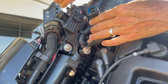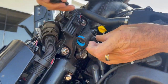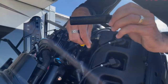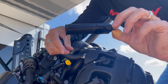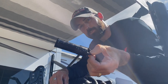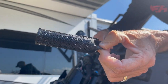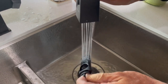And there it is. So before, there used to be a cigarette-type filter that went through here and out here, and you didn't have to take this off. Now they've gone with a much bigger filter — before it was a cigarette, now it's like a cigar, so it's a lot bigger. And this is not that dirty to the eye, but if I hold it up in the light, I can really see there are a lot of holes that are plugged. So I'm going to take this inside and rinse it out really good with my kitchen sink — just cold water and spray it out really good.